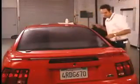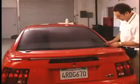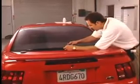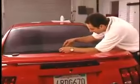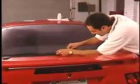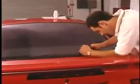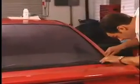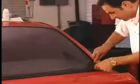Now that the film is spread out, anchored down to the window, and all fingers are gone, it's time to make your final cut. Begin at the bottom of the window. If you're using a button to protect the window, place it underneath the film. Put your Olfa knife blade down into it and draw it carefully along the glass, just barely over the dot matrix. Remove any excess film.